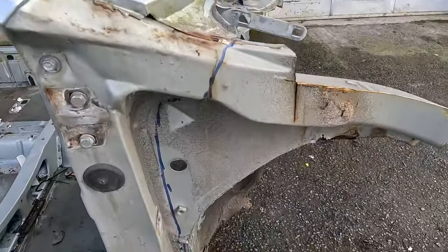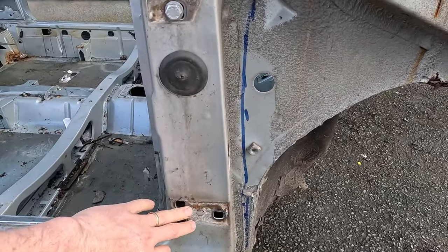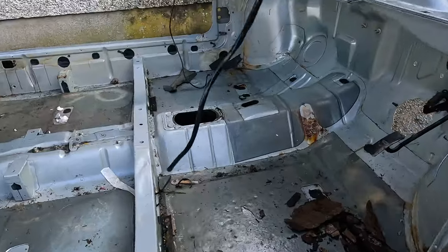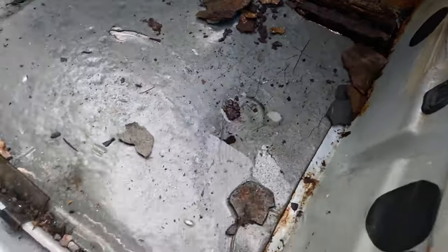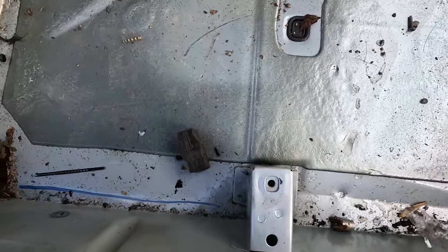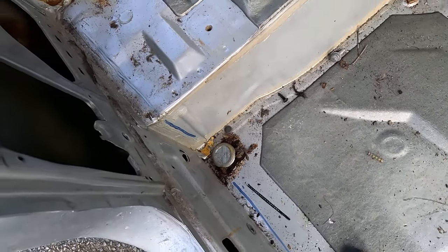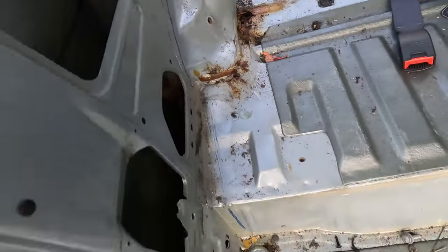What I'm going to do is cut along this blue line here. Initially I'm going to leave this pillar intact so I can mount the door — I might have to try something else to mount the door, I don't know yet. We'll leave that for the time being and see. I'm going to cut down this blue line along the floor and over there. I'm going to leave the sill intact for now — I do think more is going to have to get cut out of it, but I need to get a bit closer to offering the two up before making those decisions. I'll cut down here, up around here, and take the tubs out.